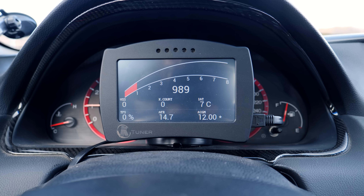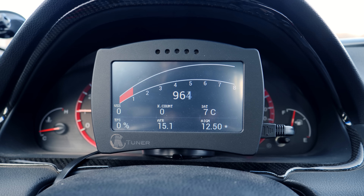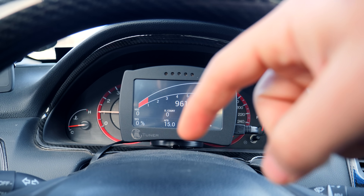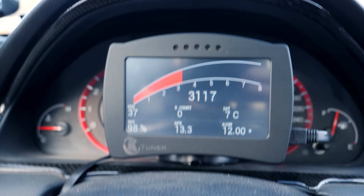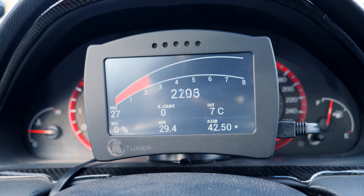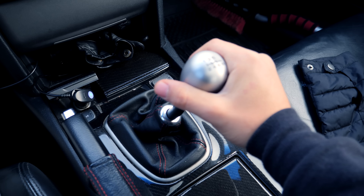This test I'm going to show you is very noticeable if you have a manual vehicle. With the car in first gear I'll accelerate and then shift to second. Once I get into second I'll put my foot down — what that shows is the delay between me putting my foot down and the car actually accelerating. Because the engine mounts are pooched, the engine has to torque before it can actually accelerate with the vehicle. One thing I definitely notice is that with these bad mounts, shifting is so much harder — it feels like you can't ever downshift or upshift smoothly.